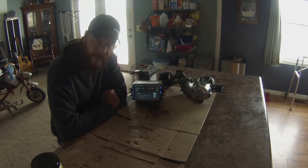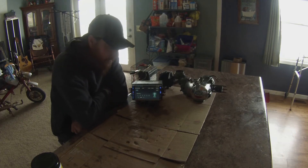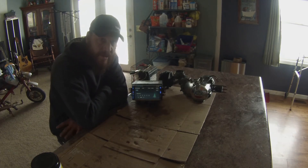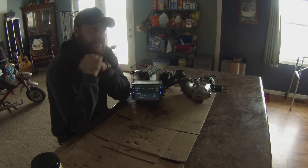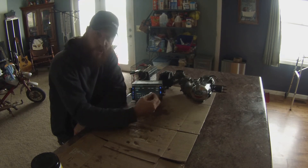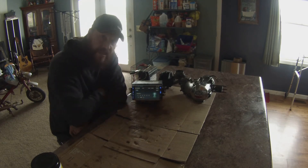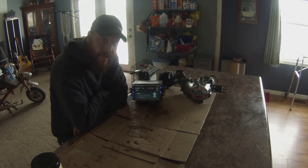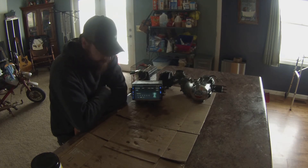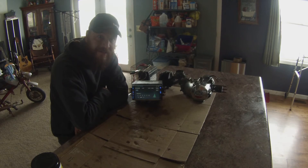Boom — it worked! So it's all good to go. I wanted to make this short video for anybody who has one of these Panasonic radios with that code on it. If you have the joystick instead of push buttons, just hold it to the right for 10 seconds and you can reset that code, get it in your vehicle, and enjoy it — stop letting it collect dust on the shelf.